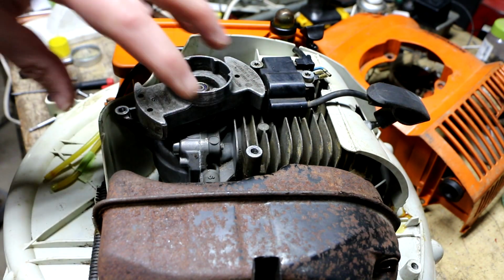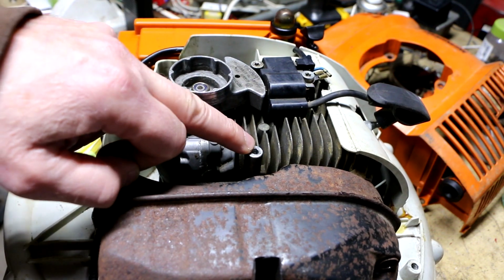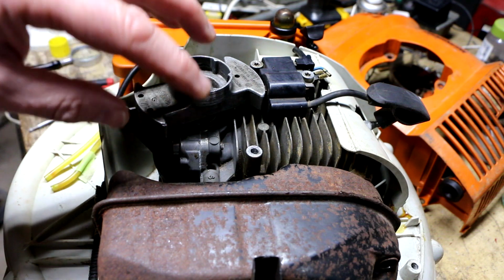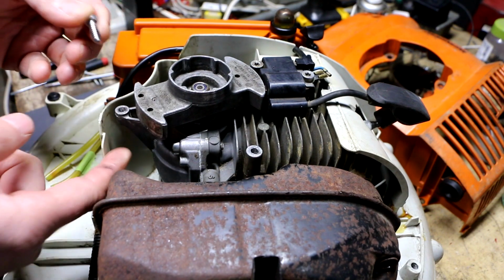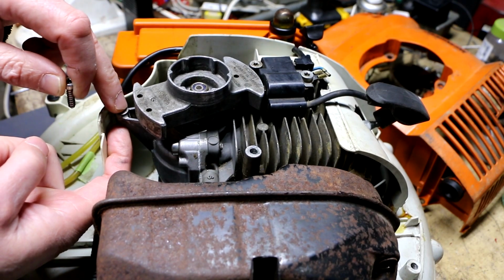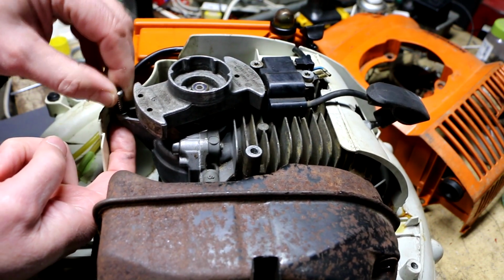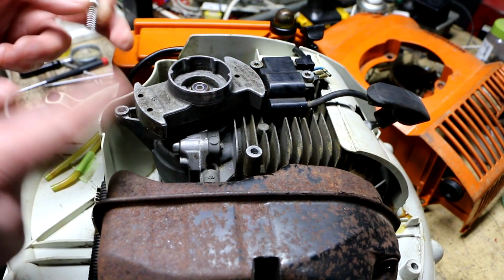And if I do this, I think what I'm going to do is, if I can successfully get these retapped, then I'll probably put the new screws in and not tighten them very hard, but just put some Loctite on the threads. So in order for this to be even mildly successful, I need to drill out these holes. Oh, my voice cracked there. I need to drill out these holes to a diameter that completely removes the remnants of what's left in there for threads. So, how do I know what that's going to be?